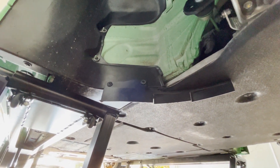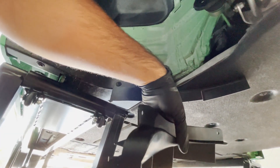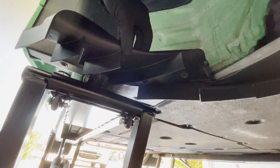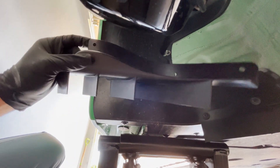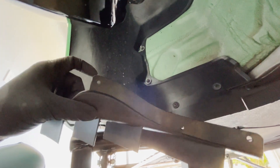The factory piece is now replaced with two separate pieces from Porsche as seen on the new GT3 and GT4 RS. The new piece is noticeably beefier on its own. It mounts using two holes that match existing screws, but there is one caveat: a third mounting hole is missing on the wheel liner, so you have to drill a hole there. The fins come with a bag of screws and a rivet, and a rivet will be used to secure the top mounting point.